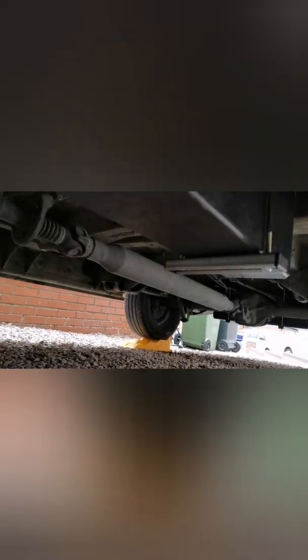I'm going to wax oil there as well, and then hopefully the tank will go straight up. A little tip: I've got clips in now. I used a jack just to hold the tank up — obviously if you do it with two people it's a bit easier. I've used the jack to hold it up whilst I get the brackets into place. I haven't tightened them up properly yet, but they're ready to go.